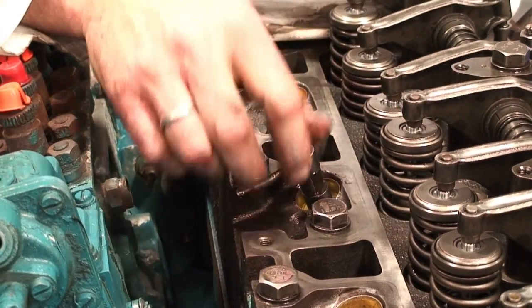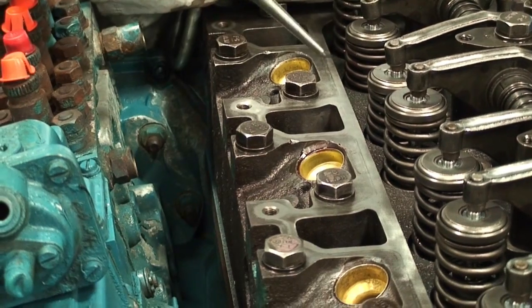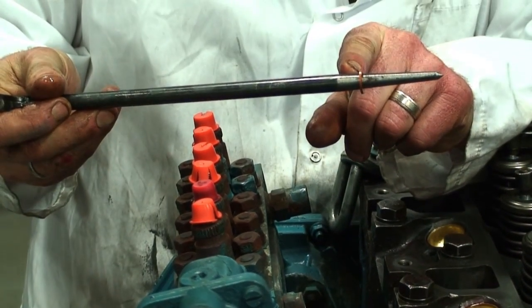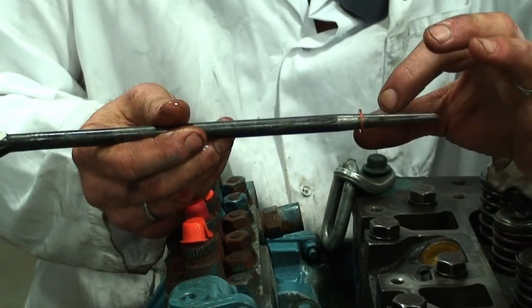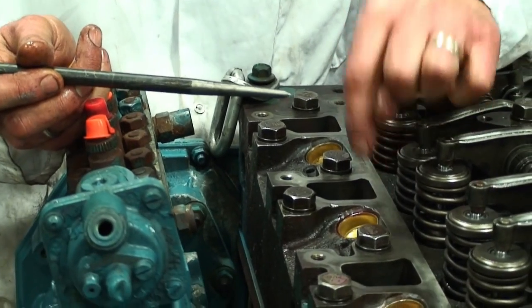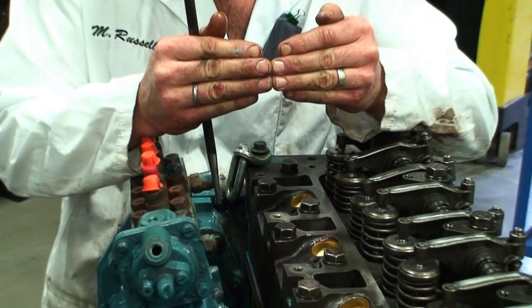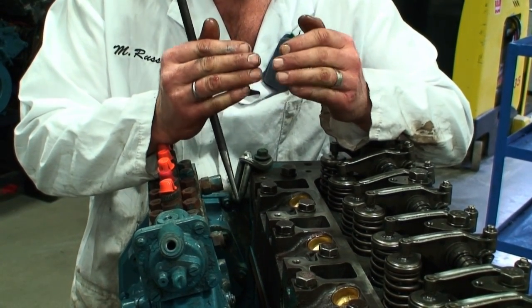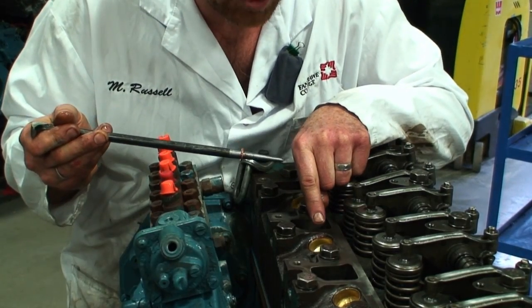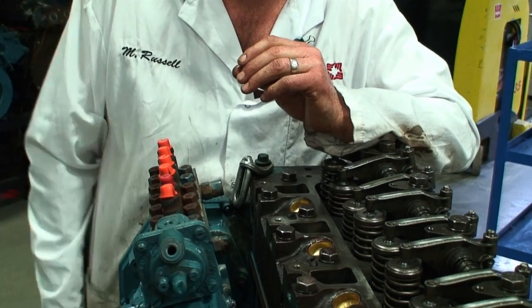A quick and easy way to remove the compression washer is — sometimes they do come out on the injector, but if they don't, to get those compression washers out, just use a tapered punch, push in and it fits directly onto it so we can always get them out. One thing that happens sometimes in the trade or even here at the college is when students take these apart, they neglect to take them out, so when they put the new one back in they stack them. If they stack them, there's not enough room for the hold down clamp, and when we torque it down we actually pull that injector sleeve, creating an uneven surface and no sealing capacity. So make sure every time you pull them out that the washer is out, do a visual inspection of the sleeve, and determine if you need new washers. In most cases we're always going to put new washers back in to promote a good seal when the injectors are removed and replaced.